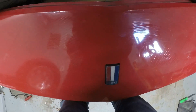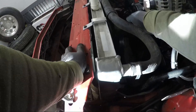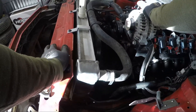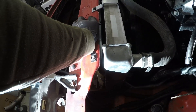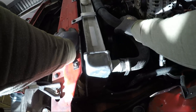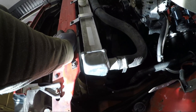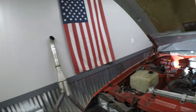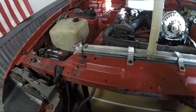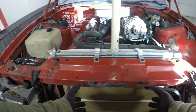There will be another cooling fan in there too. What I may do — since we still have to replace the water pump because it's leaking — I'm going to go with the F-body style that comes out up front, redo that line so it's coming out and over here to simplify things. At that point we may even be able to move our cooling fan over and double up both 10-inch fans on one side if we need the room, because otherwise that cooling fan is going to take up space right where our turbo is going to be.